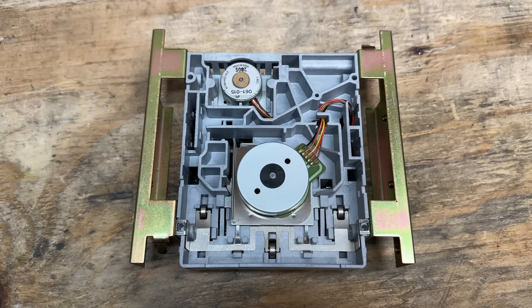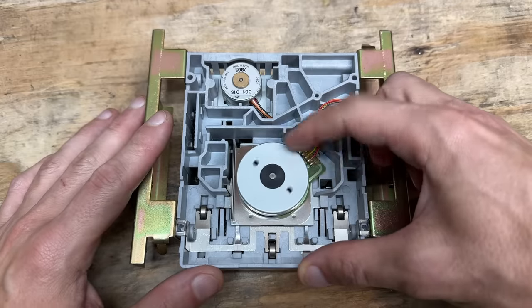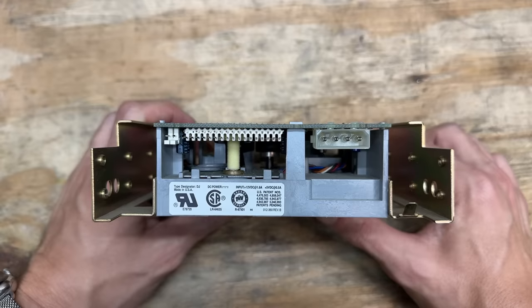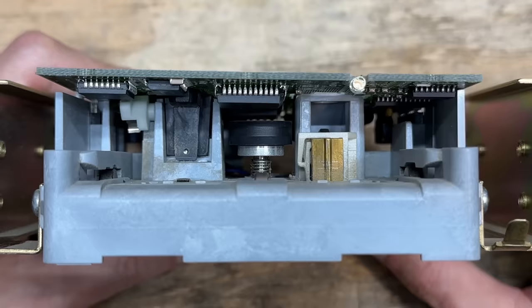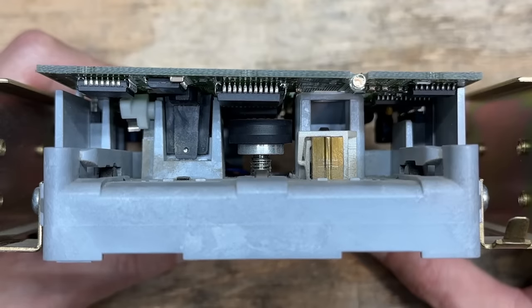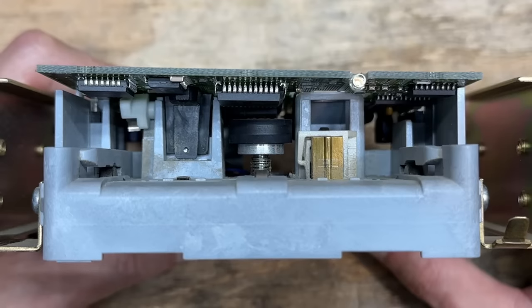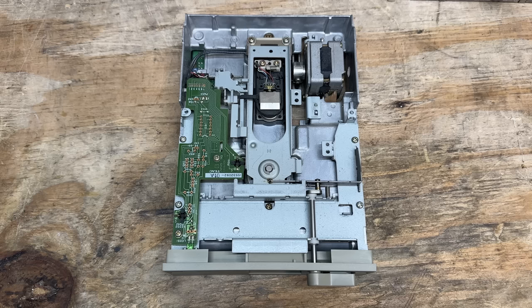And despite missing its face, it's actually in pretty good condition. Spindle motor's still spindly. I just find it awfully strange that they were using the floppy drive interface — those tape drives would have been SCSI or something. I would love to see how that works. But I only have DDS-3 tapes and I don't think those will work in this. The head is a little bit worn, but the roller's not perished — I feel like this drive would probably work.